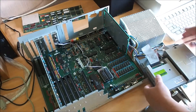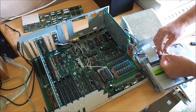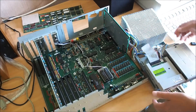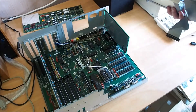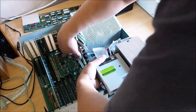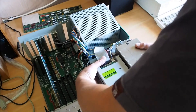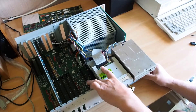Now I'm going to put the whole power supply chassis along with the drives back into the case, hook up the power for the two drives, attach the mounting screws for the drive chassis, plug the floppy disk cable into the main board, attach the power cable for the main board, and gently get it all into position.